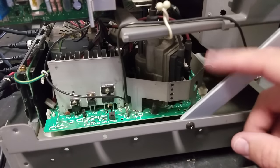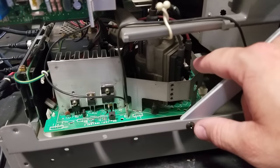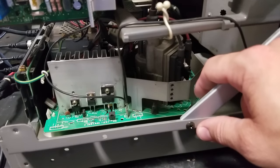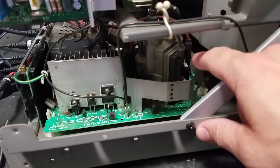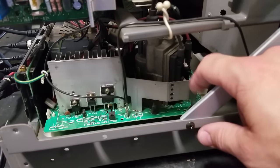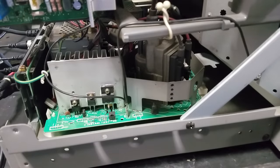Always try the sub menu settings first. Older monitors without a sub menu setting for focus may require you to tighten that top potentiometer manually. The bottom one controls brightness — so if over time you have an older tube that starts to go dim, you can come back here and turn up the brightness just a touch to help extend the use of that tube. Just know that a darkening image is a sign the tube is aging.